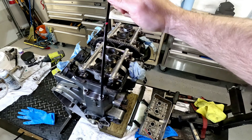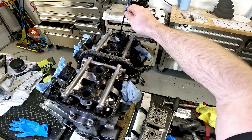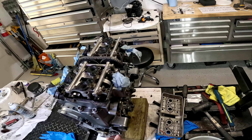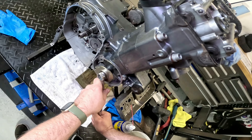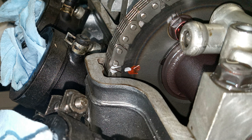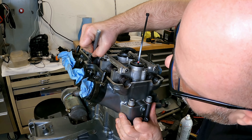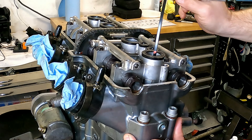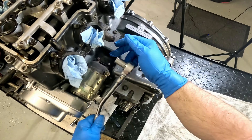Before removing the camshafts, the engine needs to be back at top dead center on cylinder number one, just like it was when I took the first set of valve measurements. Rotating the engine over to the proper timing marks, using that cable tie in cylinder number one again, and confirming the camshaft marks are all aligned with the top of the cylinder head, I can now remove the camshafts. To help with installation, I put some paint on the camshaft timing marks to make them easier to see. The first step in taking out your camshafts after getting the timing marks aligned is to remove the cam chain tensioner. Start by removing the bolt that holds the tension spring.